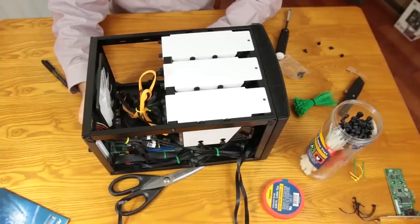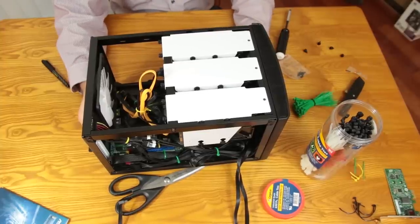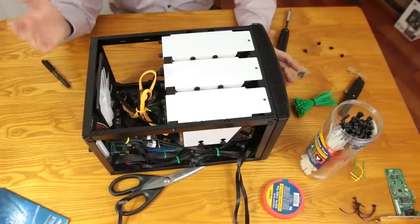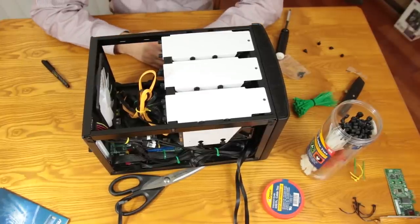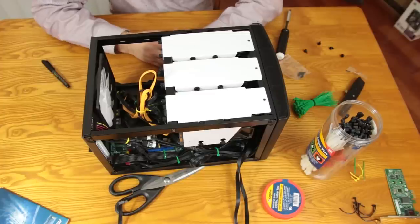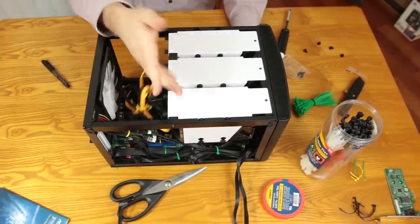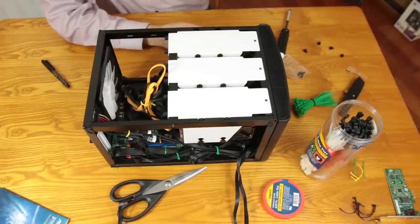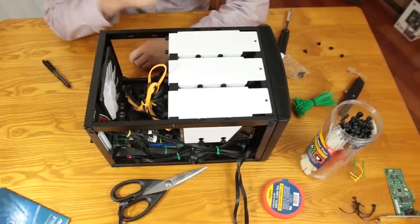I ended up actually having to switch out the power supply. I had a 430-watt in there that only had four SATA power connections, which wasn't going to cut it, and I didn't have a Molex to SATA adapter. So now I've got a 550-watt Thermaltake power supply in here — a little overkill, but now I've got six SATA power connections. If I add a sixth drive, which I have the room for on the motherboard, I now have the room for it power-wise as well. I've got my SATA data connections going from SATA 1 to SATA 5, and I'm going to run the power to it, and that will pretty much wrap this up.